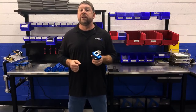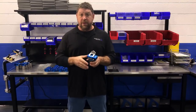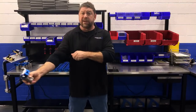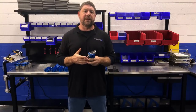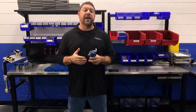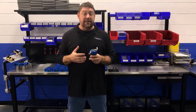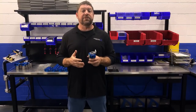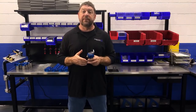That gives us an absolute rating of 35 microns, and you'd think you could just order a 35-micron filter and everything would be good — but it's not quite that simple. They also specify that at 5 microns the filter needs to have an efficiency of 87%, meaning it must catch at least 87% of every 5-micron particle in your fuel system.